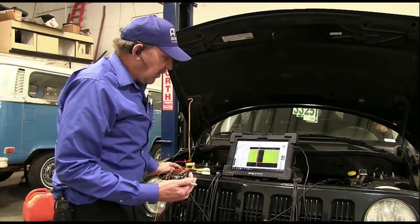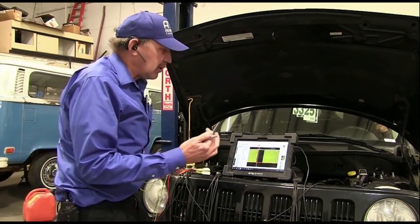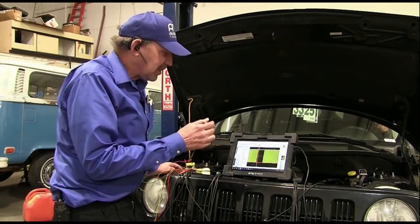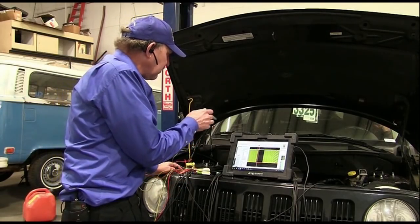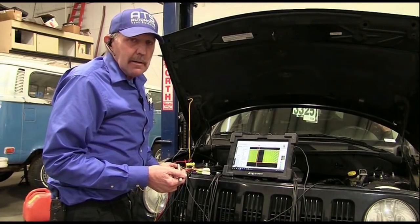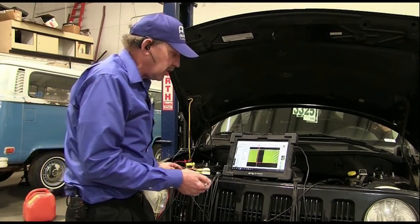So now we need to figure out why the ignition is hitting it, but putting a crank sensor on this or a computer or the harness, none of that's going to fix the car. What's going to fix the car is to fix these coils so they stop hitting it. So it looks like these coils have been replaced. I want to pull them out and take a closer look. They don't look factory. So I want to look at the coils and at the plugs and see what's going on to get so much energy kicked.